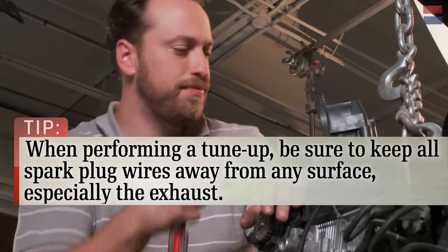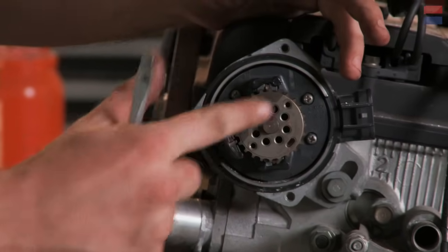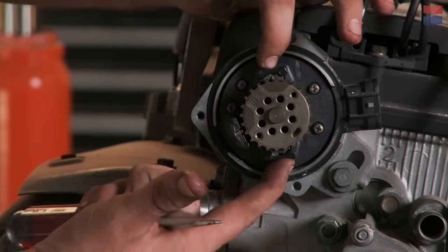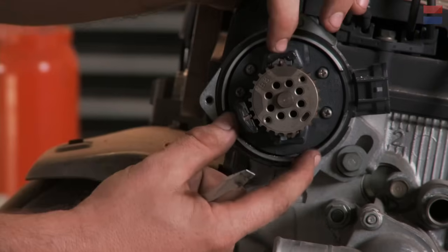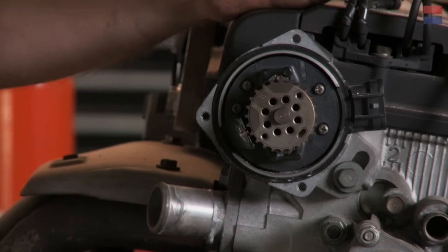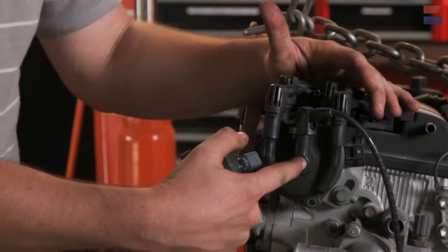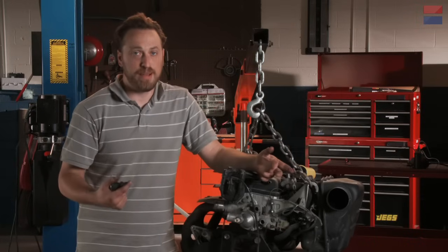But if I take this rotor out, we see something a lot different in here — a gear and a couple of pieces of plastic. That's the important part. This is actually sort of a timing wheel, and it's at the end of the camshaft that controls the valves. This tells us exactly where all the pistons are in their respective cycle. We have two sensors up here — these are the camshaft position sensors. This sensor detects the presence of these teeth on this wheel. The signals are sent out to the computer, and the computer decides exactly when to fire the coil and to fire each spark plug. So this is the first sort of electronic ignition system, and you'll notice we still have a mechanical component — that distributor rotor moving the spark from the remote coil into each plug. But it's electronically controlled, so why even bother with the distributor system? And that's sort of what happened in the last 10 to 15 years.